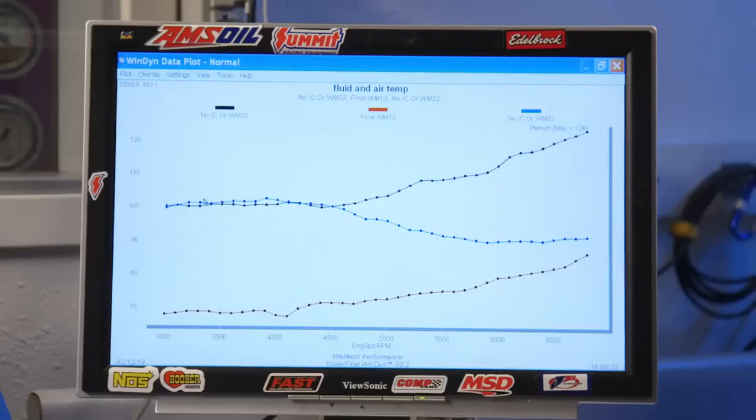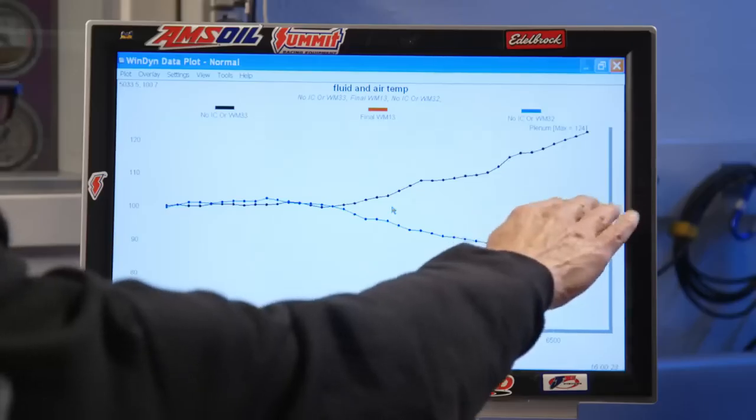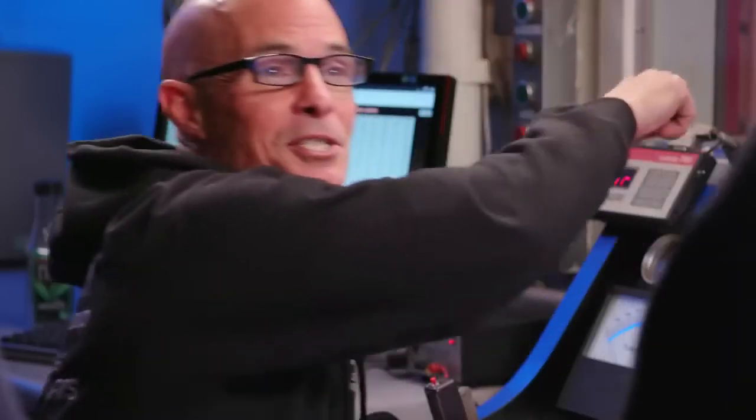If you look at this thing, the interesting thing is it starts out a lot hotter. They both start out the same, and then as this one starts getting happy and my charge temperature starts coming down, this one says, no, you're taking all that stuff from me and I'm getting really hot and I'm unhappy up here. Right, the average is right down the middle. Yeah. This one's taking what this one is losing. And even if that average was right down the middle, that would still be worse than the numbers that we're seeing right in the plenum, which is what we want it to be.